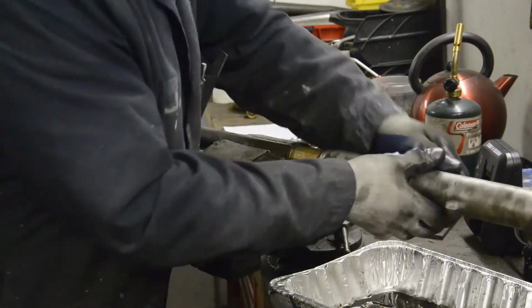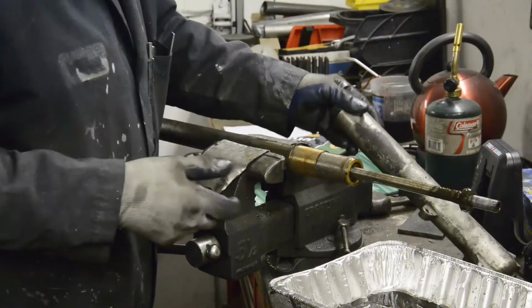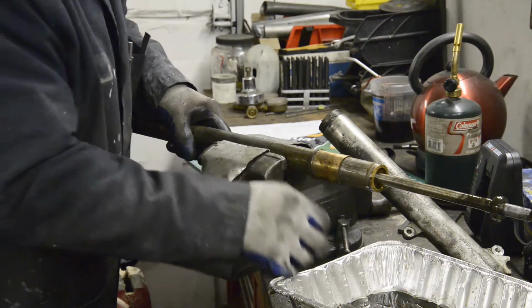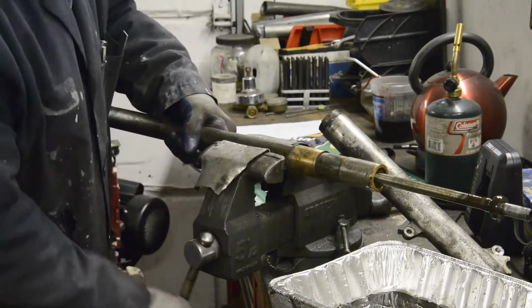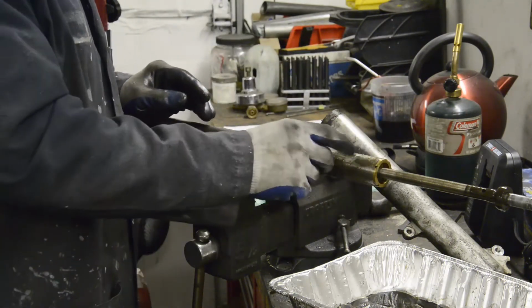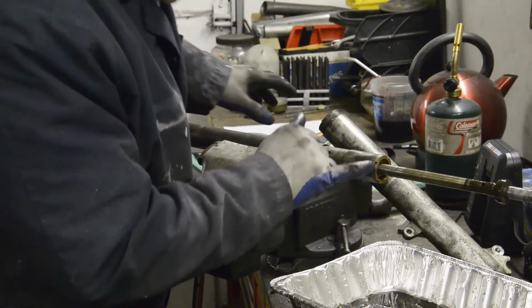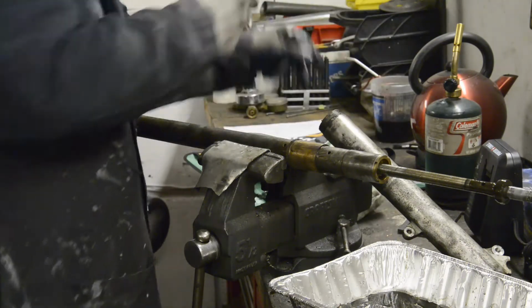Well, will you look at that? Ooh, and more water. So there's our bronze bushing, and it's thicker at this end. So you have a bronze bush here, and here it's plain steel. Let me swivel this round a bit. Few holes, and in here we have the valving. Now again, this has little bits for a C-spanner type thing. You can make yourself one if you want, or generally, once more, they're not that tight.